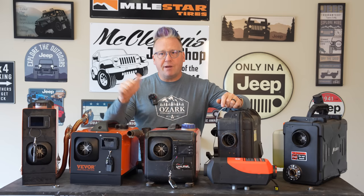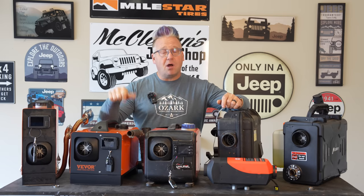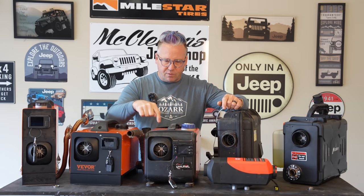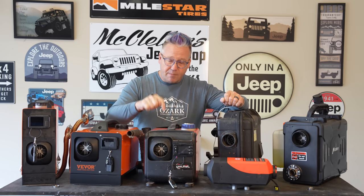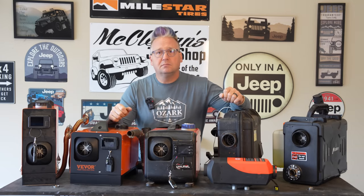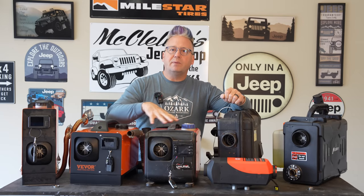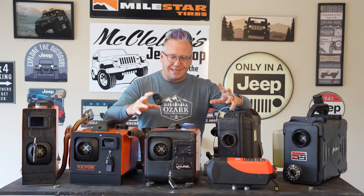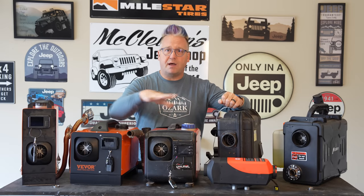You really need to take care of them. After it's been running all night and you're getting ready to go the next day, make sure you actually turn them off with the switch and let them do their whole shutdown cycle. I made a mistake with the very first diesel heater I ever used. Night one it was great, night two it wouldn't work — because I just unplugged it without knowing it had a shutdown cycle. That caused carbon buildup inside. The shutdown cycle burns off that buildup to prevent that.